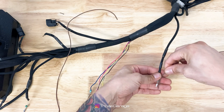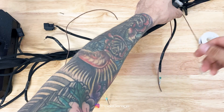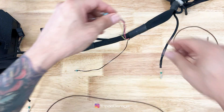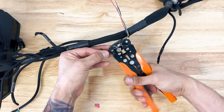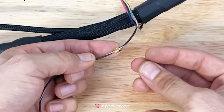Next I take some wire and make a rough estimate of length from the tip of the connector to where I'm going to make my splice. I do this for both sides. Using wire strippers I expose the sensor ground wire so I can get this brass crimp around it, which will allow me to crimp my two new sensor ground wires to the already existing wire.